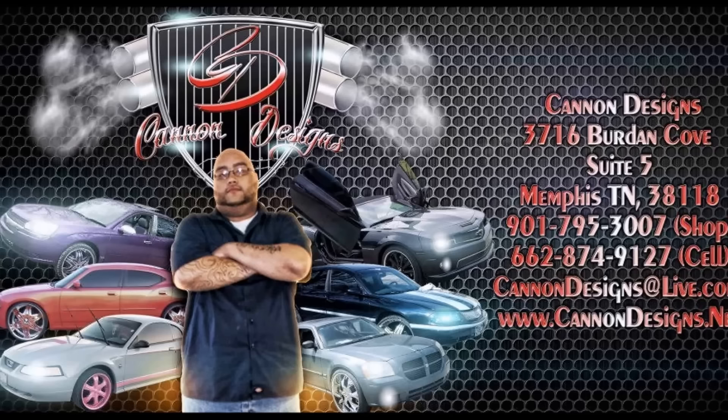As you guys can see, it's one bolt on this side that holds it in, it snaps off, and I just pull the whole front bumper forward — that way I don't have to undo all those 10 to 12 bolts at the bottom. So it's already broken down. This is the plastic piece that the old grill was on, and this is the plastic piece that the new grill will bolt to.